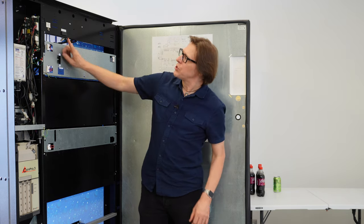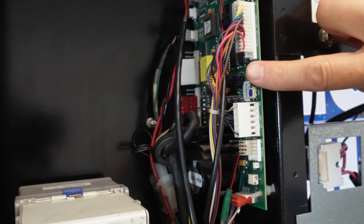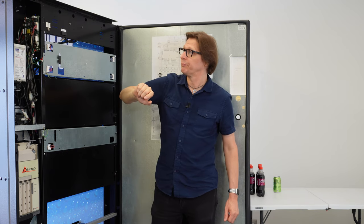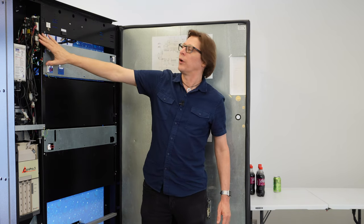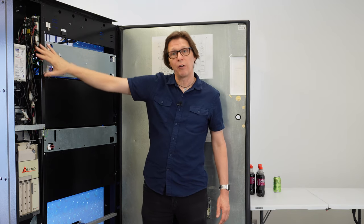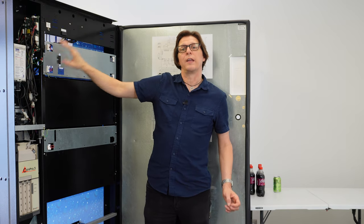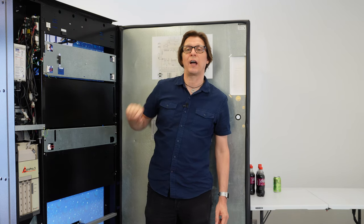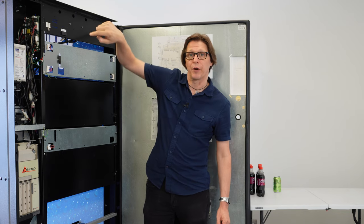It's round, and on this machine it happens to be located right here. On a board that's in the center of the door, that button can be found on the left-hand side of the board, and boards that are recessed have it on the bottom of the board near the center. Now if you open your door and you don't see the control board, there may be a metal cover over it — there will be two square holes and one rectangular hole. The second square hole from the top is where you'll find that mode button; you'll just have to reach in and press it.